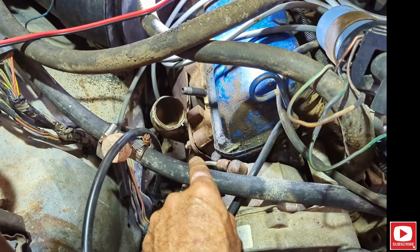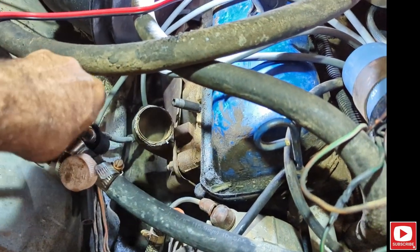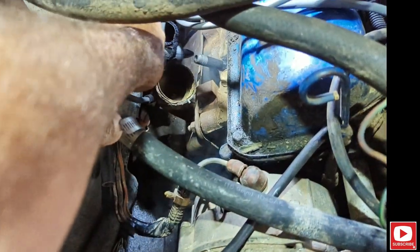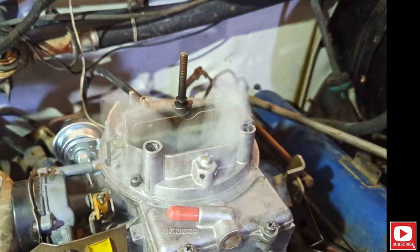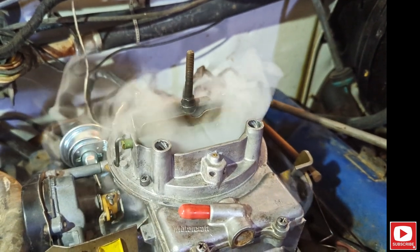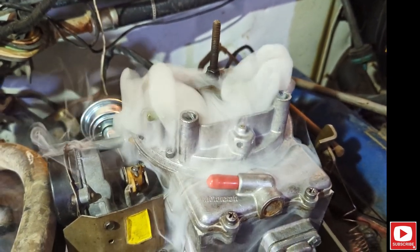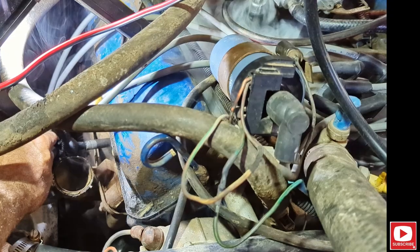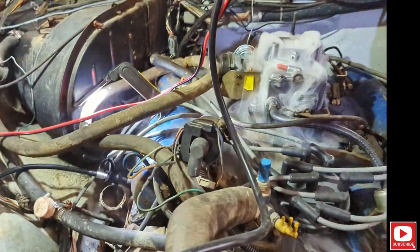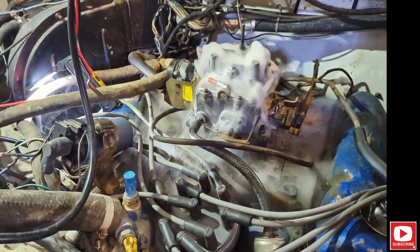Let's turn on the smoke leak detector and see what comes out of the carburetor this time. There's our smoke. So there we go — that's what it would look like if your timing was off. You would have smoke coming out of the carburetor or the exhaust pipe. There's lots of smoke. So I know by doing this smoke test without taking the valve cover off that my timing is good. That's all I wanted to show you here. I'm going to continue on trying to figure out what's going on with this thing. Thanks for watching — hopefully it was helpful.